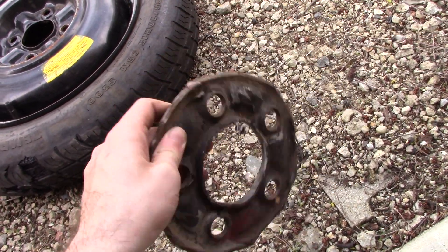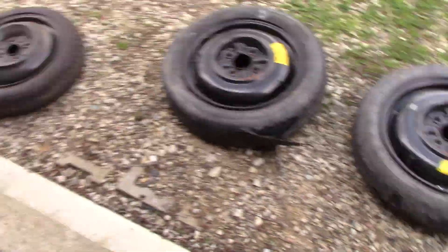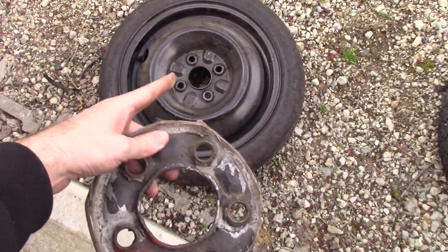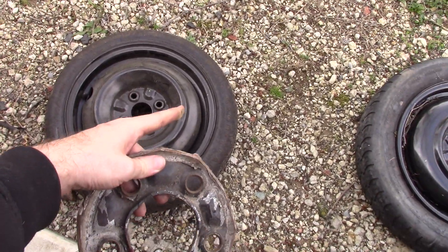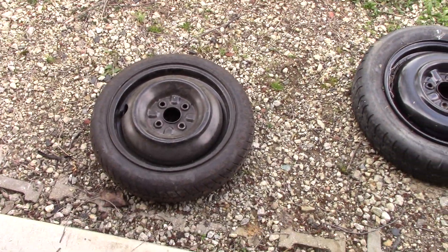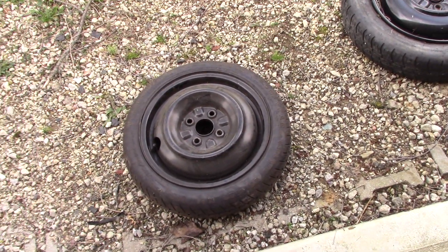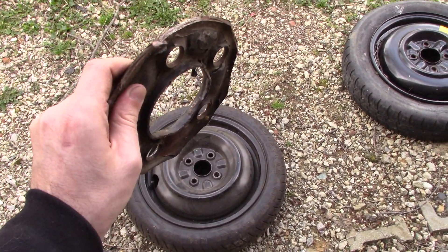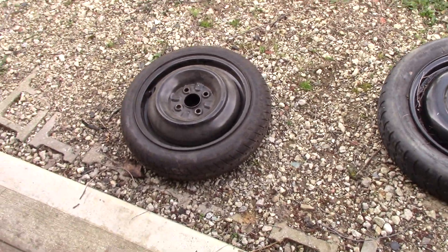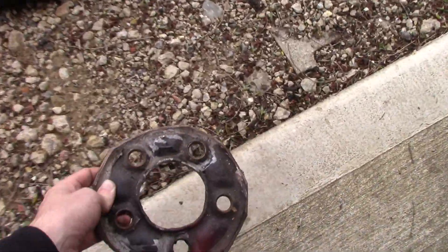If I want to go find a 12, a 13-inch, or a 14-inch donut tire for a car that normally doesn't have them, I can go do that. For example, this car here — we're going to cut that centerpiece out and put that new centerpiece right here in this donut tire. We'll flip it over, weld it from the back, and it doesn't even have to be perfectly level. A lot of guys get paranoid like, what if it's off balance? It's a donut tire on the back of a front-wheel drive derby car. As long as this thing isn't wobbling like 45 degrees when you drive, a little wobble is not going to hurt a donut tire, especially because you've run pre-ran rims that are mangled before. As long as they hold air, they're going to be fine. So do not stress about that.